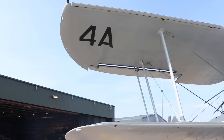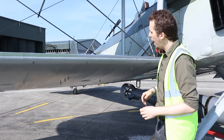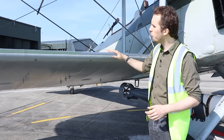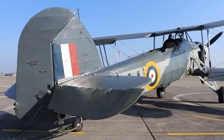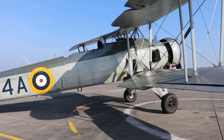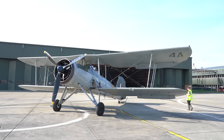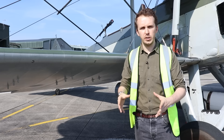Let's turn our attention to the wings. Lower wing, top wing — biplane design, very simple. We have support struts and bracing wires between them. As this is a Mark 1, you see dope fabric on either side. The wings are constructed with two main spars running perpendicular to the fuselage and then ribs between those. The dope fabric covering extends from the wings all the way to the tail, while metal sheeting is used for the engine and front portion. The difference between the top and lower wing is a slight increase in length on the top wing, which is also angled at four degrees to improve the center of gravity — one of the lessons learned from the crash of the TSR-1.